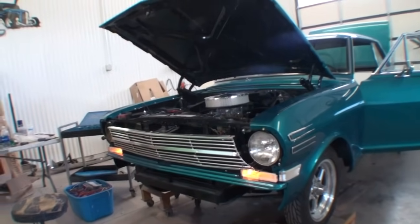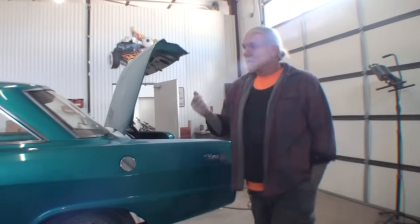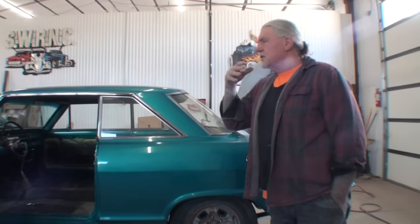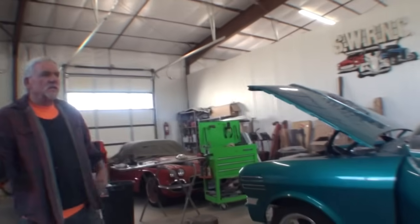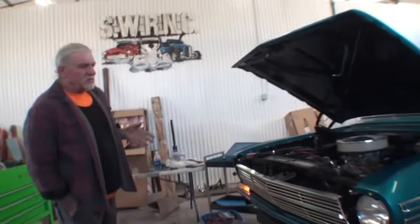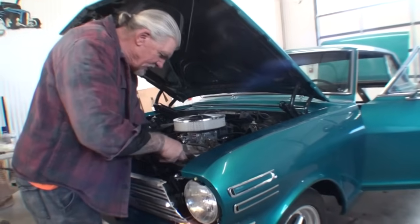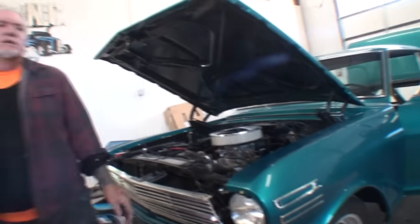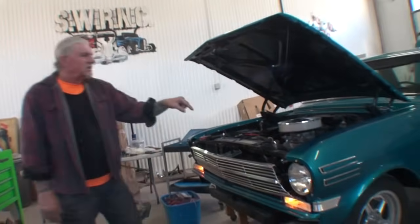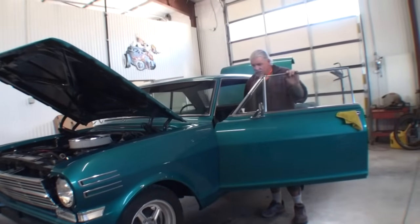When you turn the key off it'll turn the turn signal off, and the park lights in the front are working. But when you turn the key on, the blinker comes back on. I'm going to have to talk to the owner because I don't wire cars for free, and I don't do it by the hour — I have a set price to completely wire. If the owner wants to fix it right, I'll do it. If not, they can take it somewhere else. I also had to disconnect the horn — the horn itself is good but we've got faulty electrical wiring. I'm going to have to remove the steering column to actually fix that issue.